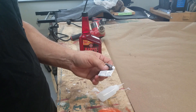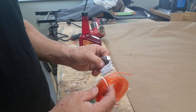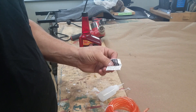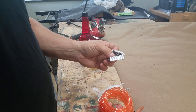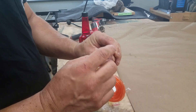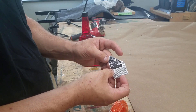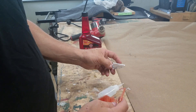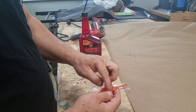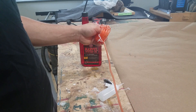Then I went to the plumbing section looking for pipe to buy by the foot and came across this — 10 feet of micro fuel line for about $4. I'm assuming it's the same thing. I don't know why there's fuel line in the plumbing section, but it's definitely cheaper. This is the size I wanted: outside diameter is 3/16ths of an inch and inside is 3/32nds. I wanted something small so there's not going to be a lot of oil sitting in the tube, because I'm going to make it somewhat long.